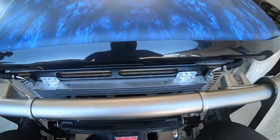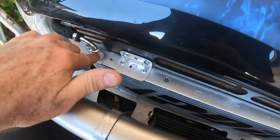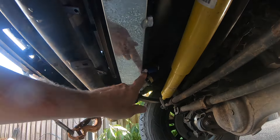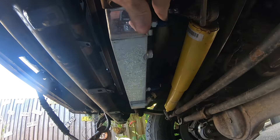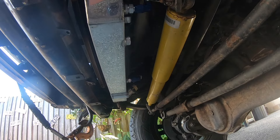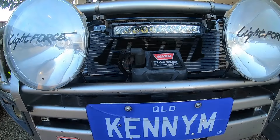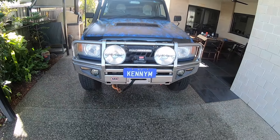I don't think I lost too much fluid — maybe 100 to 150 mils out of the hoses. Just took it for a spin, seems to go okay, no noticeable change, which I'd expect. A couple of small leaks — one there, one there — so I've tightened those fittings up. These fittings are more or less original AN fittings each side that come into the PWR radiator, installed by the local agent for Wholesale Automatic Transmissions. I've nipped them up pretty well and there's no sign of transmission fluid leaks. Well, that's it — that's the job done. Thanks for watching.